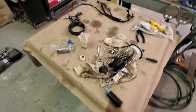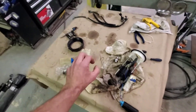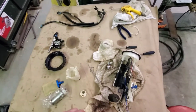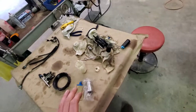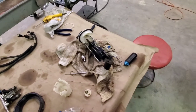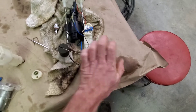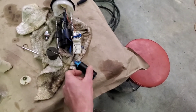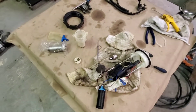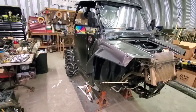Right now I'm tearing this apart, going to clean the pump and everything in here, put it all back together, clean the injectors, do an injector cleaning. Hopefully that takes care of the running issue. I did notice it was missing a little rubber boot here which is supposed to keep the pump pressed up in there, so it may have been losing pressure at the pump itself. I'll put it all back together and see what it does.